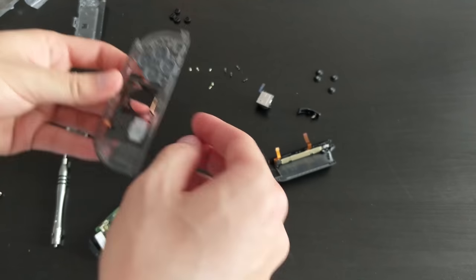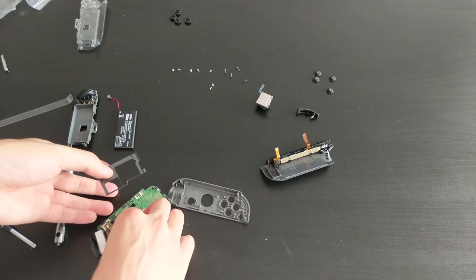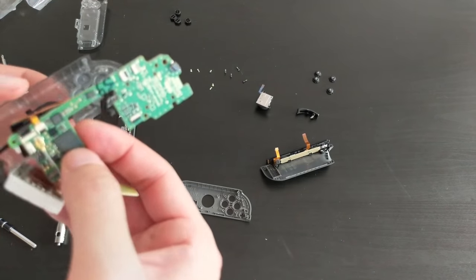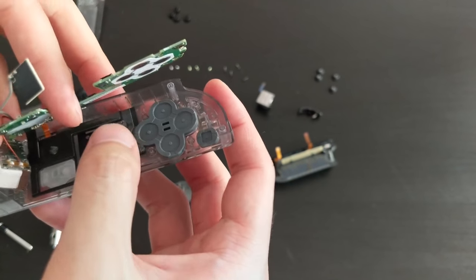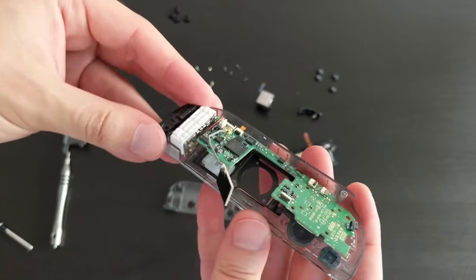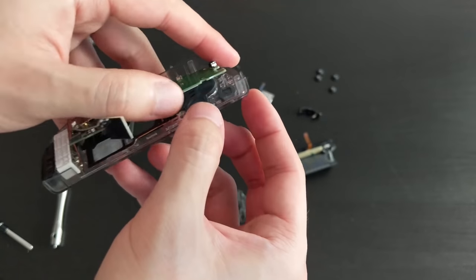And done. So now we have all these dangly bits. So, antenna down first. Antenna is almost down. Antenna is down. And the rumble bit, okay. Put the IR sensor back in first, and then the rumble, and then everything else. Just make sure the buttons are still where they should be. And we should be almost good to go. All right, that was so much easier.